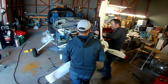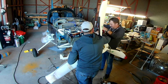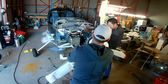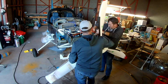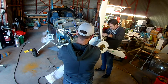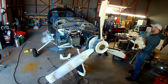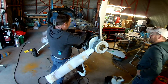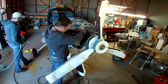We have to do them in that order. We'll be done with the left bank after phase two. Phases three and four deal with the right bank — we have to fit the line first because once we attach to the fuel filter, we can only move it a certain distance and direction. We need to get it in the best position possible to avoid touching anything else, then measure and get the fourth line that goes to the firewall.